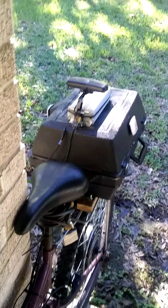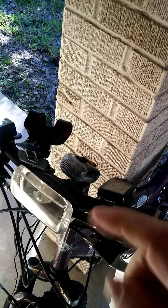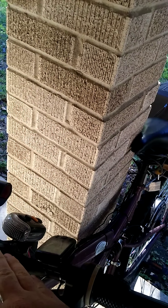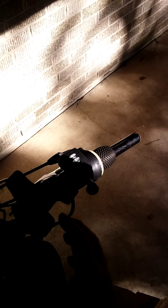When you hit the brakes the light turns on at the back, including the turn signals. I've got this other light right up here that I haven't fully wired up yet, but I'm going to run it down the frame and into the battery box so it can run off the batteries. Here's the speed controller — it runs into a potentiometer inside the battery case so you can give yourself throttle.